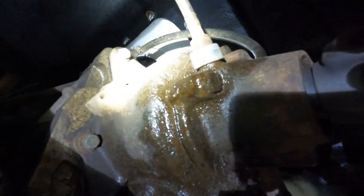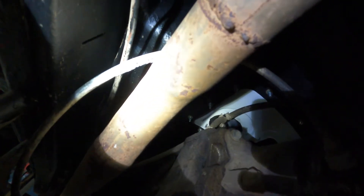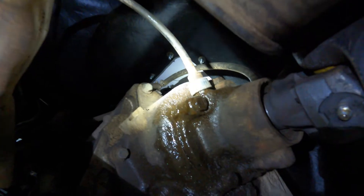I only got about an hour, but I'm gonna get a little bit of work in here. One of the things that's been really bugging me is that my CJ leaks a ton of oil — just a massive amount of oil — and it started to leak less oil. So I'm gonna do a little bit of work on this today. It looks like most of the oil is coming from the speedo cable. I also noticed that the speedo cable has been up against the exhaust and it's melted a little bit, but it does still work.